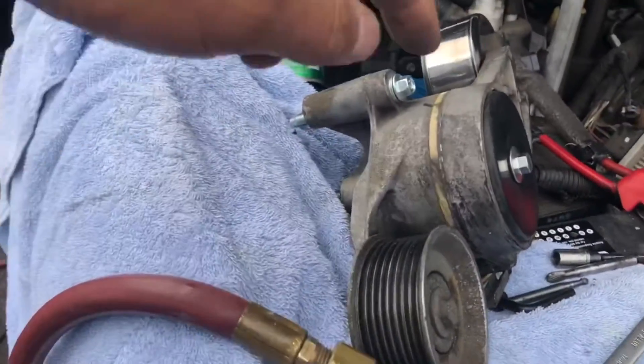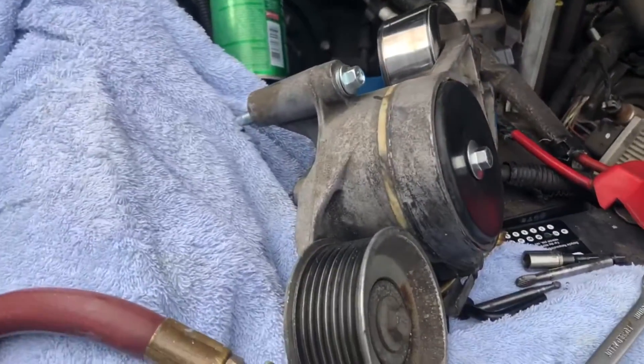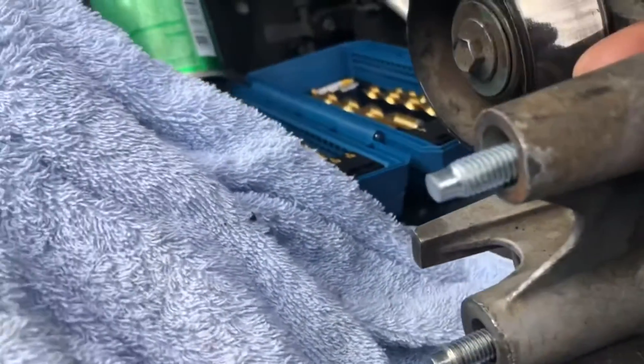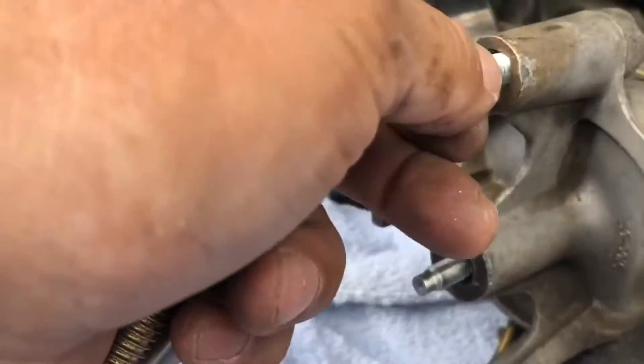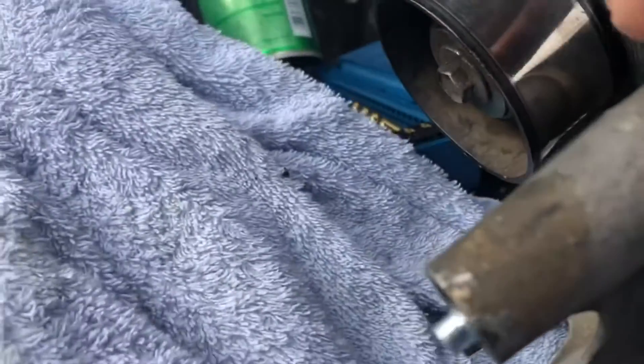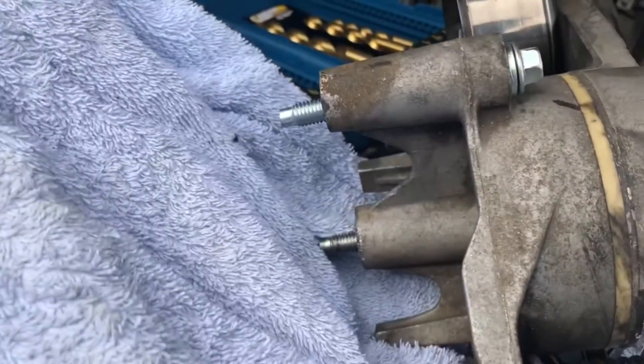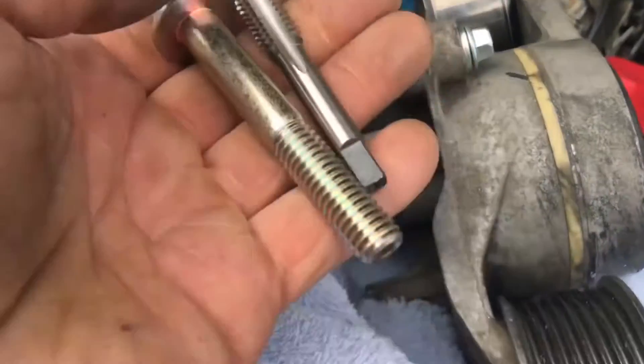So this is the piece that went out. That bottom bolt that we tapped out is right there and it only comes through about five threads. Same with the top stock bolt, and you can see how sloppy that is on both sides — there's tons of room. The thing that's flawed with this design is that's why they rattled out and broke, so we're going to upgrade it.